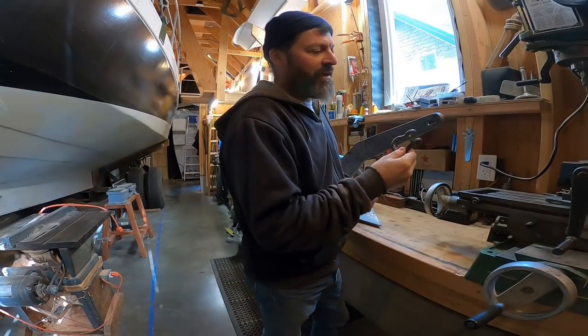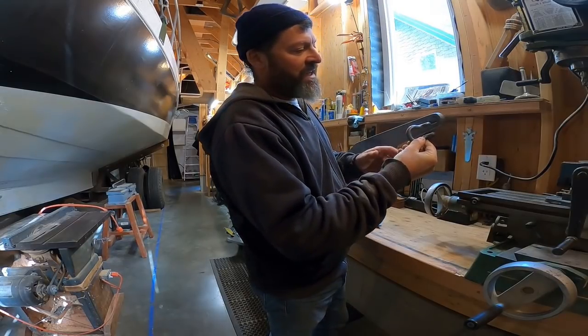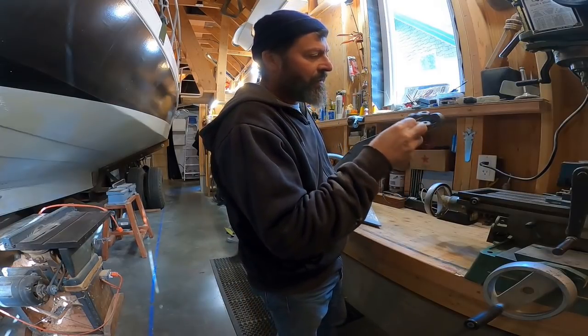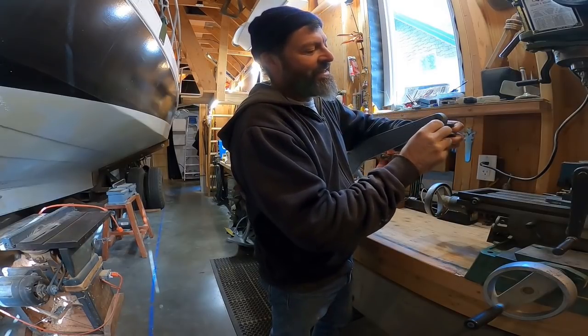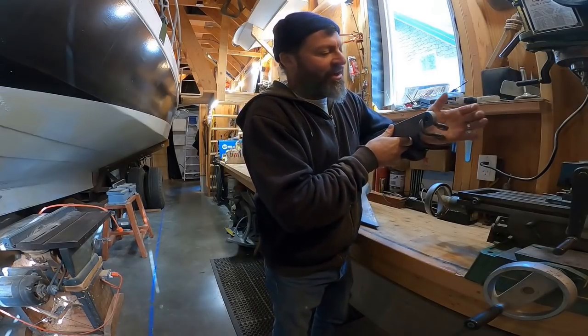Let's talk about that shackle jam that we saw in that cobblestone footage. We can see here that an appropriately sized shackle, 7/16, will fit through the slot, and that's good. Unfortunately, it's not enough clearance. And in situations like this, the shackle jams. You just can't get it to go. I don't care what you do.